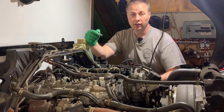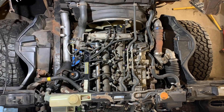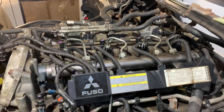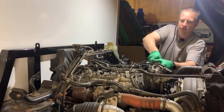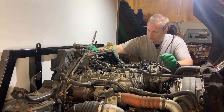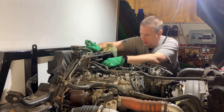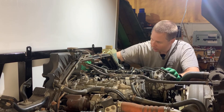I'm going to put these two into the rail to see if we get anything different — and this is the part where if you were reading the old Haynes manual it would simply say assembly is reverse of removal. The camera just decided to stop recording halfway through, but anyway we've got all the fuel lines back together and the rail back in place. I just need to tighten up both sensors. Make sure when you do the final tightening on the front sensor that it doesn't turn the housing to a point where you can't get the plug in — you may need to hold the sensor with a second wrench. As for the back, it doesn't matter what the orientation is because the plug comes straight out the back. This one should be pretty close to tight after you've spun it in by hand. Pop the sensors and the wiring back in.